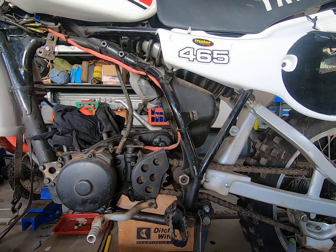Here's the proof that you can't run these old bikes at 30 to 1 or anything like a modern two-stroke fuel ratio. You'll see those big ugly gouge marks on that piston — that's actually where the aluminium has melted and stuck to the inside of your cylinder.